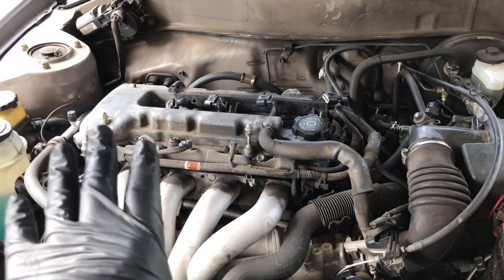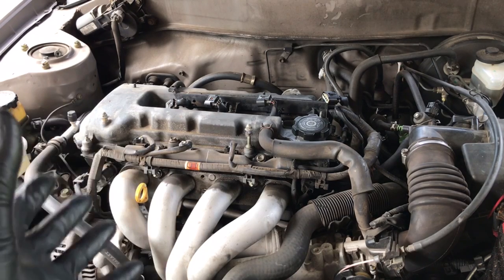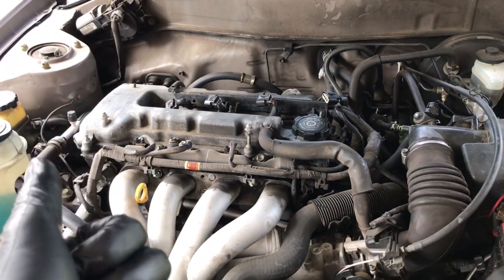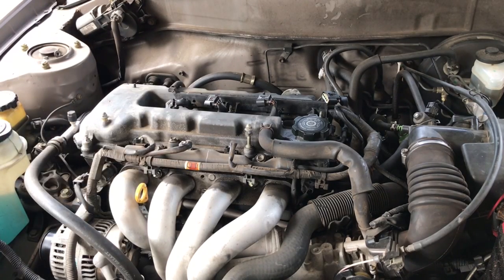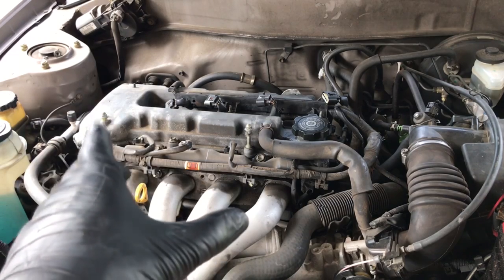So while the engine is warm and has just been run, the cylinder walls are coated with oil and the pistons have expanded to their largest diameter, and they make a better seal. So while the engine is warm, we have great compression. I'm no mechanic, and maybe some of you guys can comment what all this is really telling us about this engine, but I am assuming we can narrow it down to the rings by this, and that when the engine cools, the ring is re-sticking in the piston,